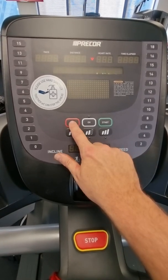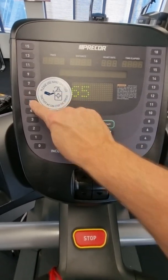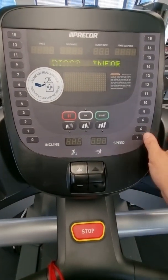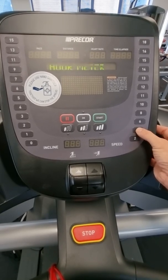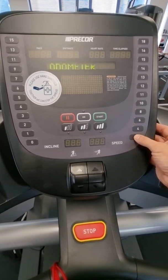To get Ks and hours, you want to hit pause and then 6-5, and that'll get you into the diagnostic mode which will give you Ks and hours. The number 2 and number 4 here are your up and down arrow buttons, so you're going to scroll through these.